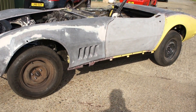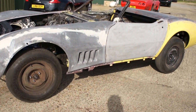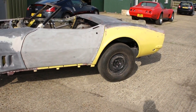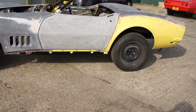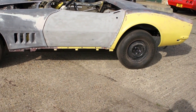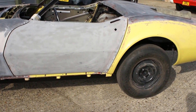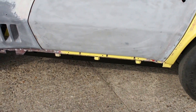It just seems to make more sense to make all our mess now, take it off, wash the chassis down and clean it. Then I think we'll maybe try and wrap the side rails and stuff like that so that when it goes to the painter he won't make too much mess. We've also got the body shimmed pretty much where we want it now. We've had to use extra shims on the rear to get our door gaps.